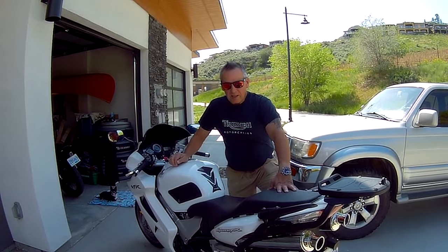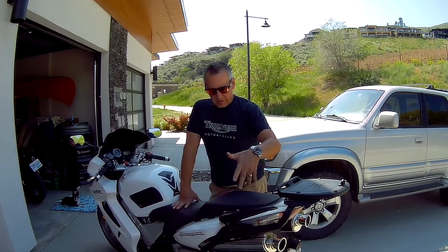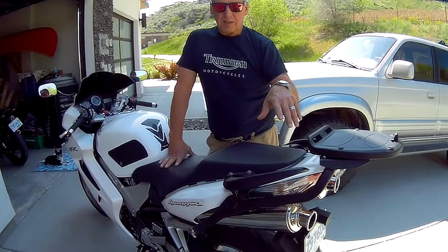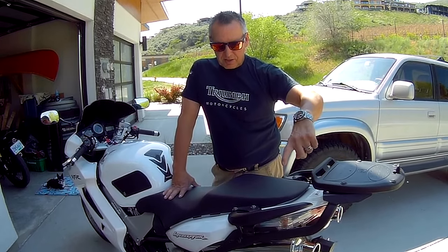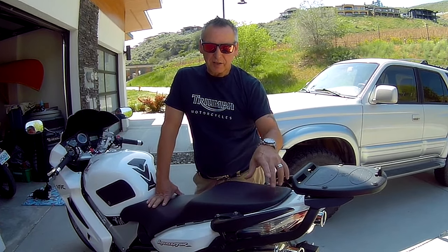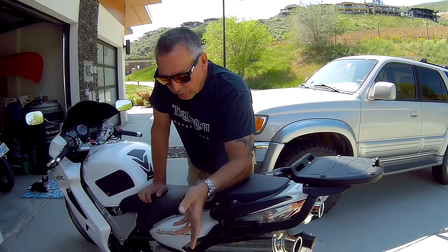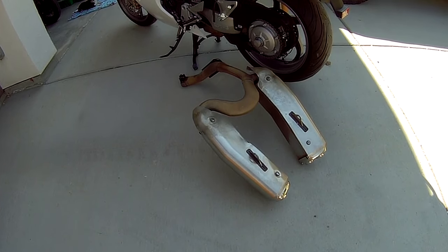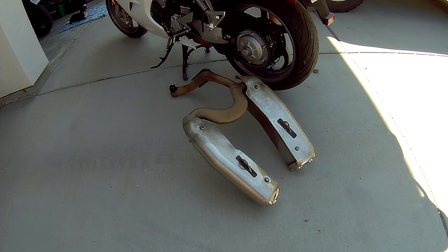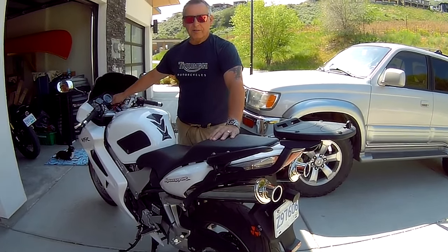Here we are back the next day - it took a little longer than I was expecting. The four bolts facing down and the two facing up - so six bolts total underneath the seat - were a real pain to get back in again. I eventually figured out that I had to do the back two first, then the front two, and then the bottom ones afterwards. So just be aware of that. There's the old pipe. Pretty substantial weight savings - probably about 15 to 20 pounds lighter compared to the Stay-in-Tune pipes versus the stock system.